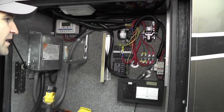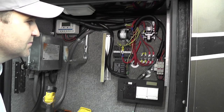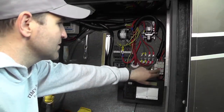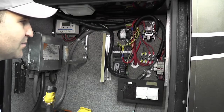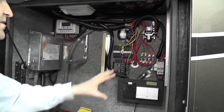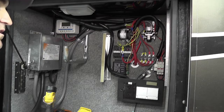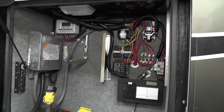Yeah, this is something that we had here from some other solar projects. This is a DIN rail, which is a small rail that you can mount any type of terminal blocks or fuse mounts. It just makes it a real versatile way to do this type of mounting on a wall here. We could have used the inline, but I think this is a little cleaner look, and I just like the install better. And this also allows you to disconnect the solar. It does, yeah. These fuse holders you can open up and use as a disconnect. So that's another reason I do like them.